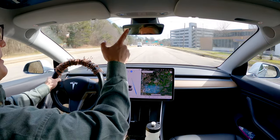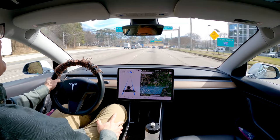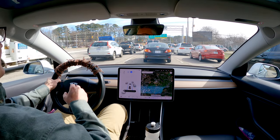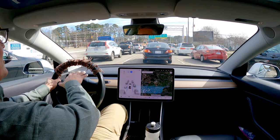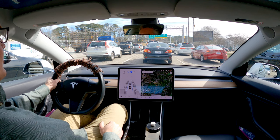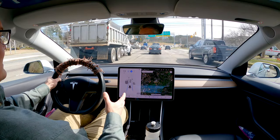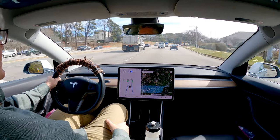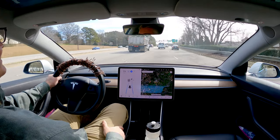There is an in-cabin camera in the Model 3 and Y, and one will be coming to the S and X, but the camera in the 3 and Y is not capable of the kinds of attentiveness monitoring that the very specialized camera in, say, GM's Super Cruise can do. That system can see through sunglasses and measure very minute changes in where your pupils are pointing and how open your eyelids are. It's not like there's a software switch Tesla can throw to go hands-free with the camera doing all the driver attentiveness monitoring — so you're still going to have to hold on and provide a minimum amount of torque without kicking it out of auto steer.